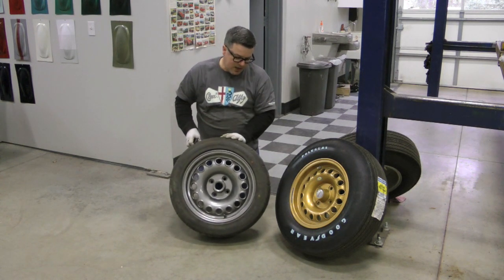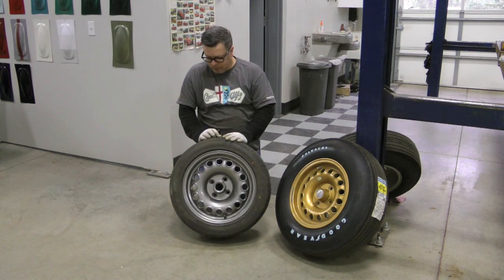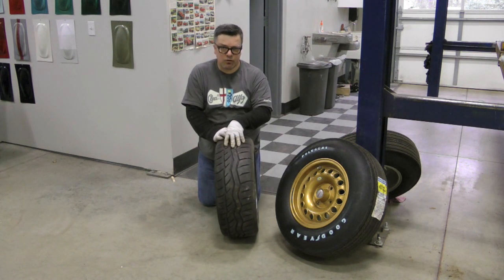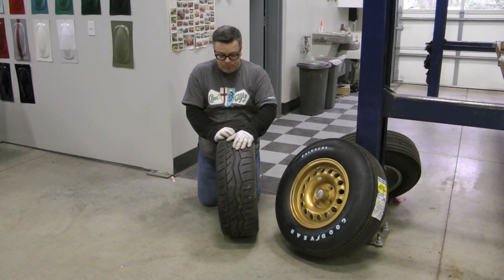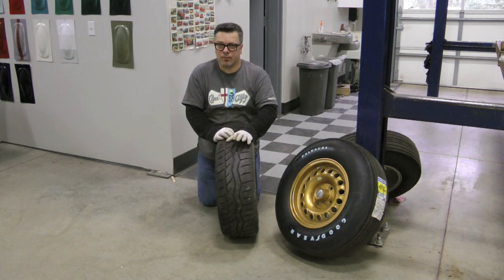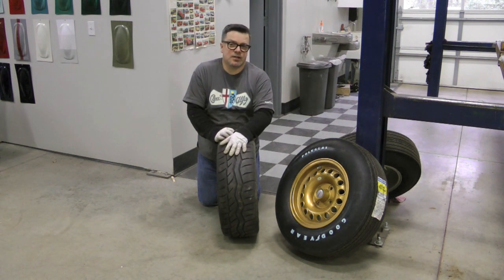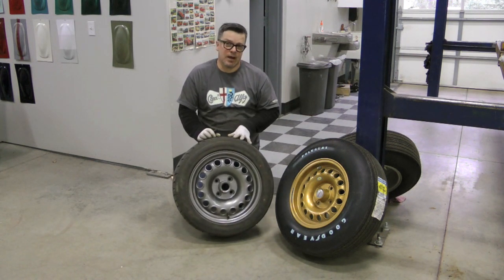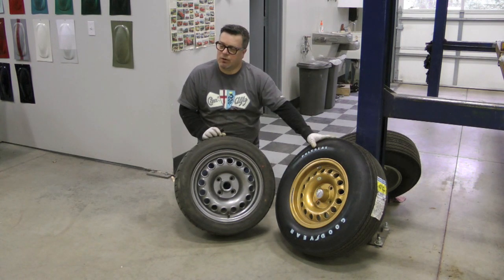It's got a good track configuration, so if you're out there doing a track day event you're going to get good grip from these. Once you get heat in them - that is the key statement. Make sure they're good and hot before you start pushing the boundaries of your car because they don't act too good when they're cold. Because of the large gapping and large exit vanes, this tire treads water very well. For a modern component tire with good rubber and fairly cheap, this isn't a bad way to go. At the 15-inch level you have lots of options; at the 14-inch level you have very few, and in performance capacity even fewer. Most 14-inch tires tend to be consumer quality - you get a lot of miles but not a lot of grip.